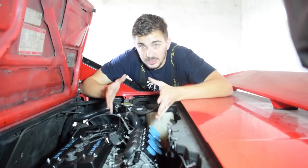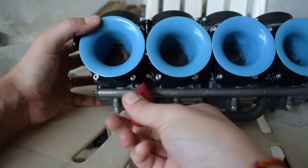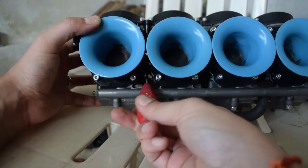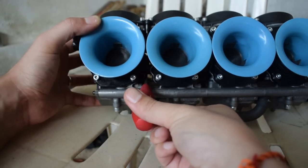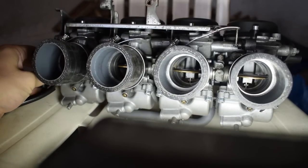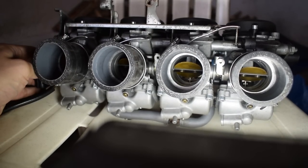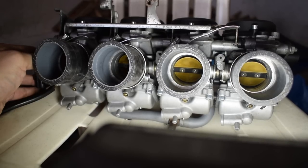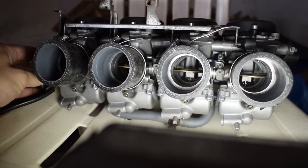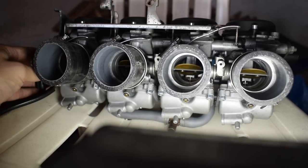Let's take a look at my CBR 600 F4 bike carbs. As you can see, they're adjusted with a little screw that sits between each individual carb. When you turn this screw, you're basically moving the throttle plate. I've adjusted it purposely so that my last carb is completely off compared to the other carbs — this is the maximum adjustment in the opposite direction — and it's such a fine adjustment that you might have trouble seeing it with the naked eye.